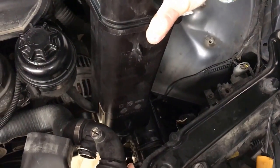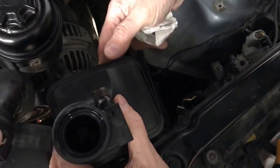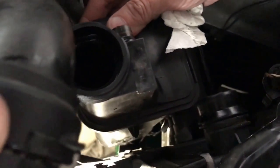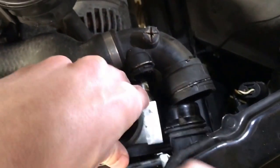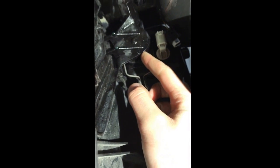Put a little more silicone grease on when you're done. To put the tank back in, it comes out the same way it came out — just wiggle it down, it only sits in one way. Make sure that notch right there is lined up and move the hoses out of the way — they're very flexible and won't break. Once it's down there you'll hear it click. You might get hung up right here, so just move that aside and it will sit in. Just wiggle it back and align it — it only sits in one way. Push down on it and check under the car to make sure it's lined up, then wiggle it into place until it falls in. Come down here where the clip is and put it back, but don't push it all the way in yet until you're 100% sure the gap is closed and there's nothing in it.